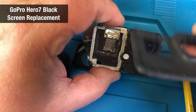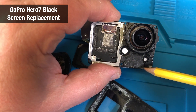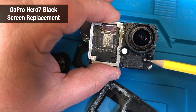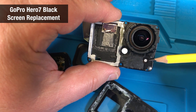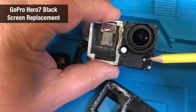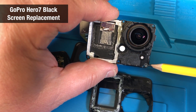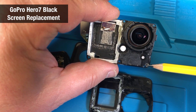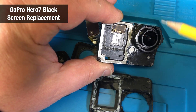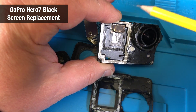The cover was glued on with double-sided tape in this area. You need to be careful that you don't poke in here or in there — this is a microphone, so you cannot put a screwdriver in here and pry around. You can go up to this spot, but if you get too far, we have a problem. This front spot here was hot-glued with some silicone.